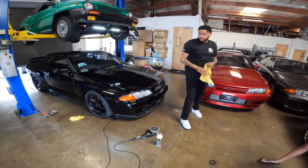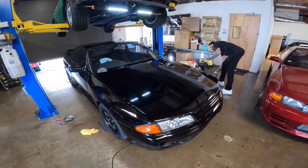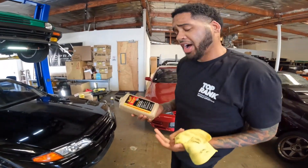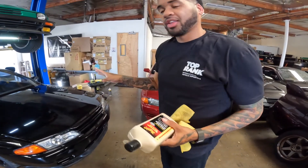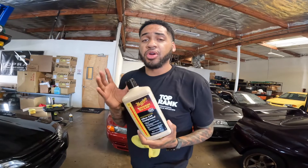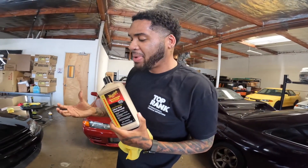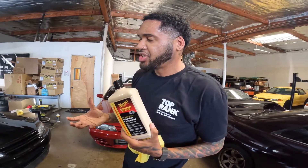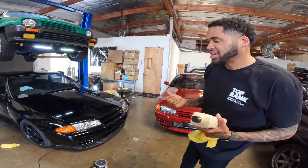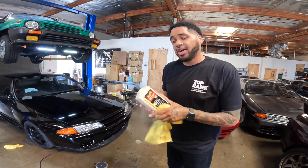So what are you using to do this? For any detailer — expert or beginner — Meguiar's is always your go-to. Your 105 is usually your heavy cut, and you can go with a polish using the 205, and that's kind of how we're getting this finish. I've used this on anything from SVJ Lambos to R32 Skylines — any and everything. We did a 105 with a heavy cut pad and went around the whole vehicle to get most of the imperfections and holograms out, then followed up with some 205 with a lighter white pad, which went around the whole car and gave us some really good results. You can typically find this at your local store or on Amazon — Meguiar's is definitely something you should try out.